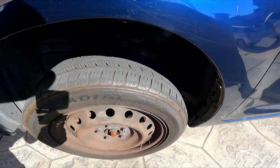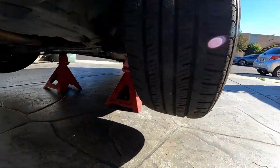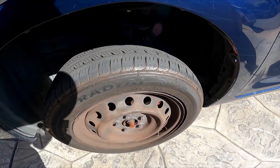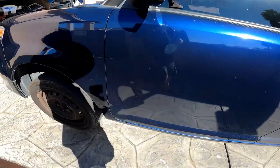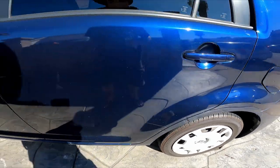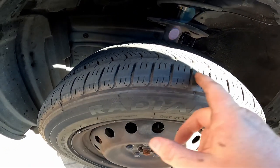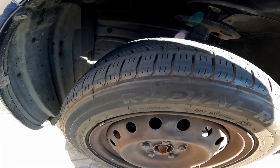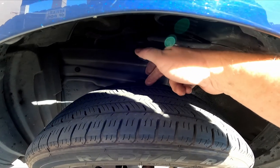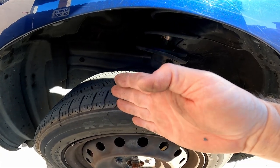Now that I've got both wheels off the ground, you can see where this tire is wearing — kind of on the outside, really wearing on the outside. So there's a definite alignment issue going on — could be too much toe or too much camber. Here's the back tire — you can see the tread pattern on the edge is a lot different. That's a good sign the alignment is off. We'll get that fixed once we get these struts replaced. Outside wear is usually some type of alignment issue — either camber, toe in, something like that.